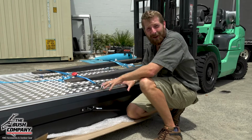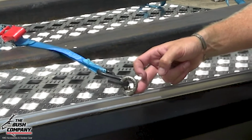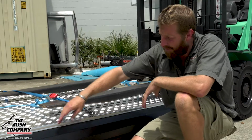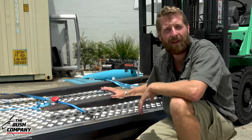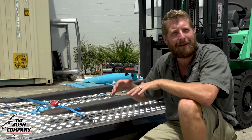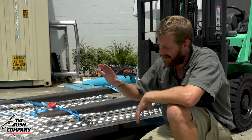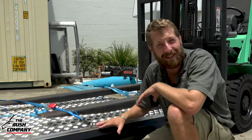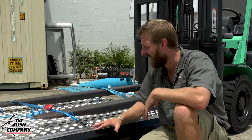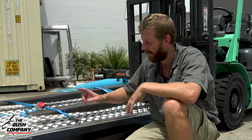Actually, when we're putting the tents on, we take eye bolts with an M8 bolt underneath. Pretty simple. Slide them in the roof rail, and we just use the forklift to aid us in lifting the tents on. It allows us to get finer angles and measurements and position it out. But what I want you to notice here is basically we are using the roof rails to lift the tent. All right, so yes, it's more than strong enough to be able to lift the tent on these and to move it around. So if needed, great thing.